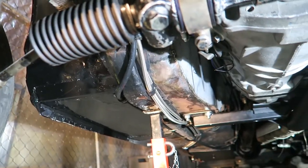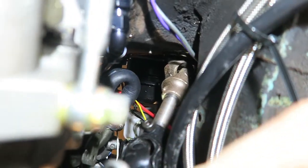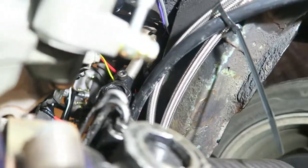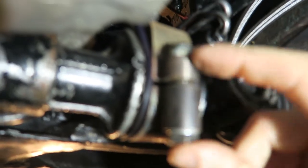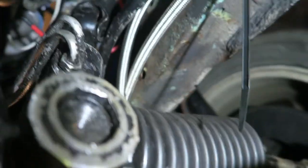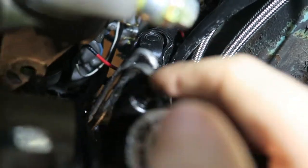There's a little bracket attached up there that connects to the stock 1200 steering column — it looks quite solid. The brackets are quite tight but I can undo them, and there's a nice polyurethane bushing in there. I can undo them and take it out if it ever breaks or needs a rebuild. The best part is that this is a power steering rack, so lines run all the way up and through the vehicle.